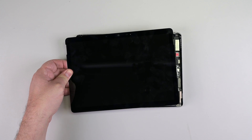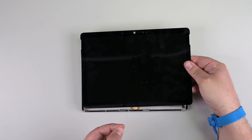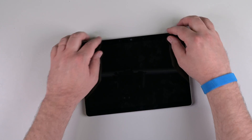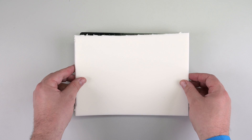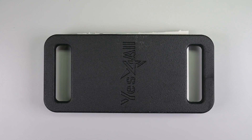Flip the display over and remove the protective liners from the adhesive strips. Use the lip of the chassis to align the top edge of the device, and then lower the display into place making sure it sits flush. To bond the display, place the bonding frame onto the device and push down around the perimeter to secure it. Place a foam pad that is symmetrical and covers the full perimeter of the frame over the bonding frame. Next, lower a weight that is at least 50 pounds but no more than 66 pounds onto the foam pad. The weight should fully cover the full perimeter of the bonding frame and have consistent flatness to allow for even weight distribution. Leave the weight on for two minutes.